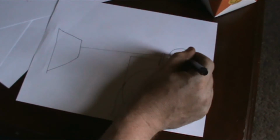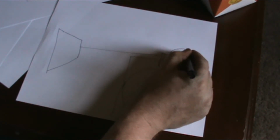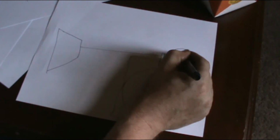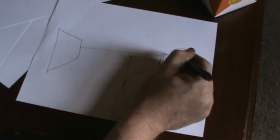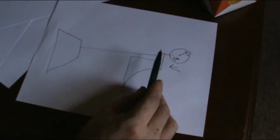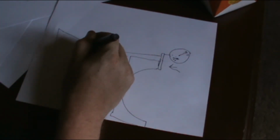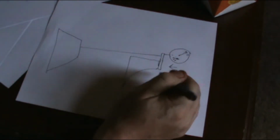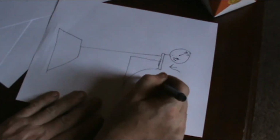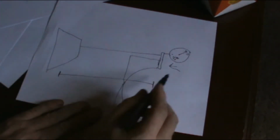Okay, you are going to get a reading, and let's say the thing goes to here, it's pointing at the 2, and let's just say it points at the 290. Okay, 2, and it's pointing at the 90. So that means that from 3 inches, 3 inches would be somewhere down here, we are 290 thousandths up from 3 inches from here. So you get what I mean? Like if we took this pinion out, 3 inches, and this is the center line, would be somewhere to here.